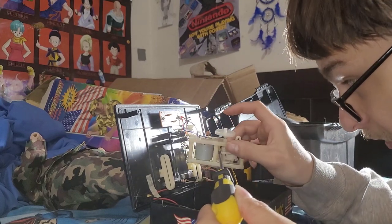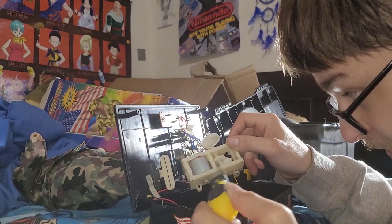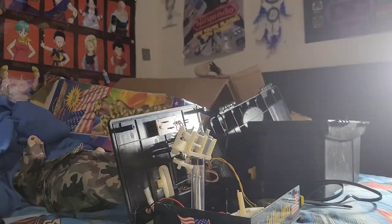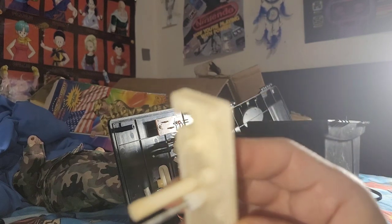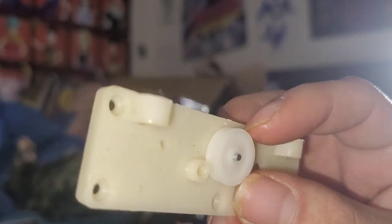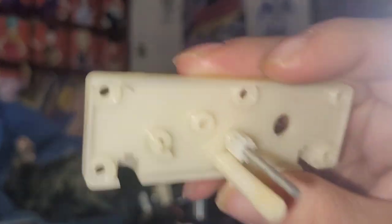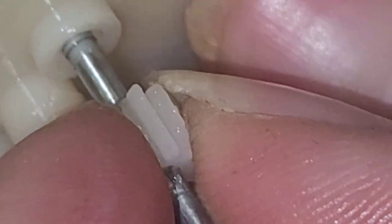Next you're gonna unscrew five screws and the one screw on the opposite side of the gearbox to get into it. Be careful because the gears can fall out. After removing the gearbox side screws, you'll see the 10-tooth gear connected to the shaft piece — that's the piece that goes onto the legs and moves the drive belt. You can see it is in fact split; you can see the metal shining through. That is a split gear and we have to replace it. Slide it off the shaft — it shouldn't be too hard.